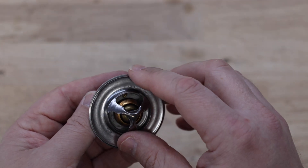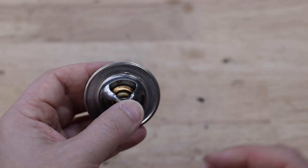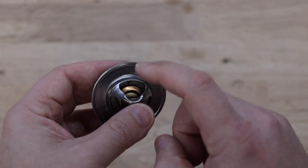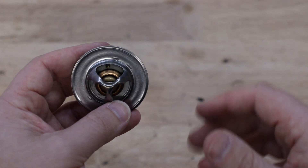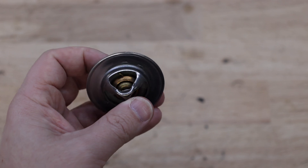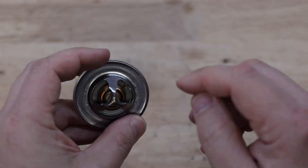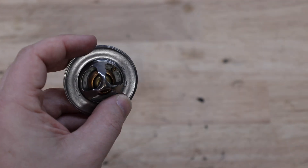What I think we're going to do is either remove this pin and open that hole up, or place another hole in it to give a little bit more flow through it. On my car, I'm okay making this modification. You can actually buy thermostats that have holes drilled in them — it allows a little bit of coolant through while the car is warming up. You shouldn't drill it too big, but I'm probably going to put a one-eighth inch hole here or remove this pin.